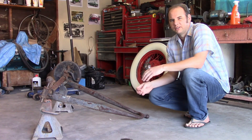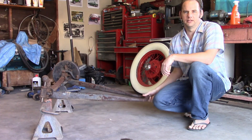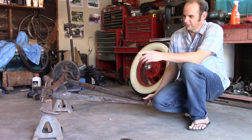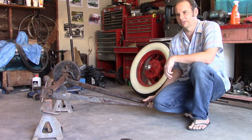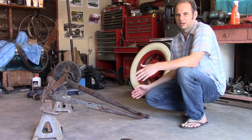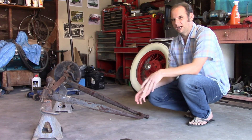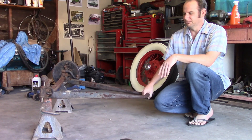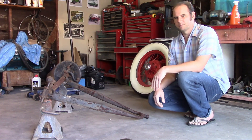An eighth inch is not a lot — any more than that, I'd probably worry about it and want to correct it. Another big thing to keep in mind is if the frame has too much sag, the back of the engine will be lower than it should be, and also the transmission will be lower. The front radius rod attaches to the bell housing, which means the mounting point for that will be lower than it should be. When you move this down, the angle of the kingpin changes — this affects the caster angle. These cars were set up new with a few degrees of positive caster, which makes the front wheels want to turn in toward each other and makes the car want to go in a straight line. But with too much angle, they can start to fight each other — usually around 15 to 20 miles per hour the wheels can start wobbling. You don't need to move it very much to add one or two degrees, and that's all it takes to mess it up really good.